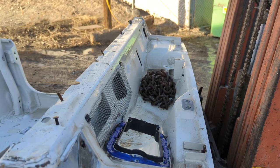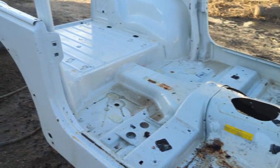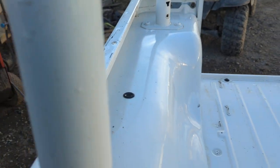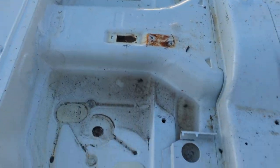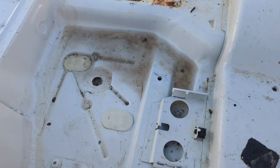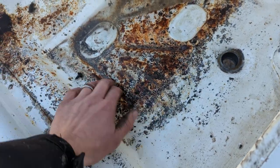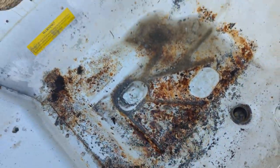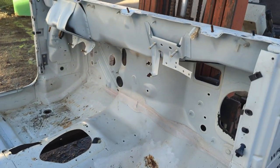The chain's just up here for balance. The firewall is super clean, no rust anywhere here. Back area, cargo area, nice and clean. This wheel well — nice and clean. That wheel well — nice and clean, inside and out. The bottom was just washed, so there's a little water in it. The back floorboard, passenger side — clean, a little bit of surface rust here, but nothing cancerous on the floor. A wire wheel or brush will take most of that off, if not all of it.